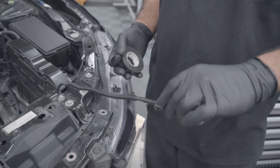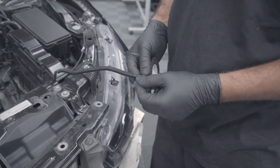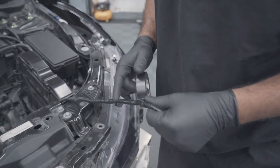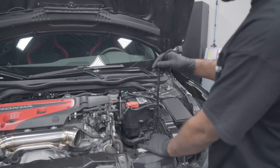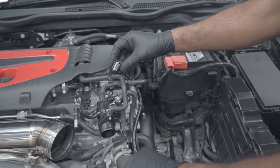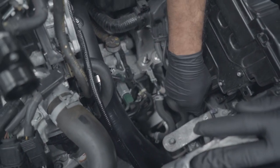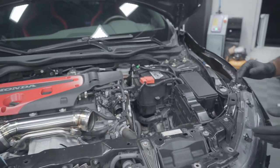In the kit, PRL provides this little wiring loom. It has a slit or slot that's open on one side — start it on one side and work your way through. What I like to do is put some electrical tape on it, sandwich it at first, and just run a nice tight weave. Once this is nicely taped up, slide this connector in over by a hose here. Let it rest just down below, keeping it away from where the bottom of the box would be — move it over just a bit, and now you're good to install the box.